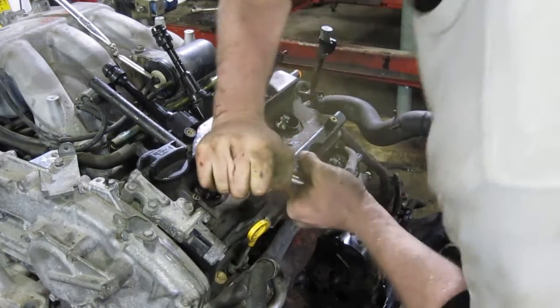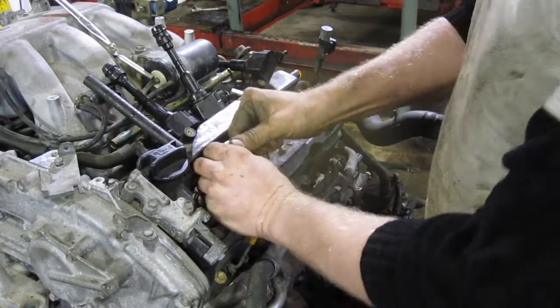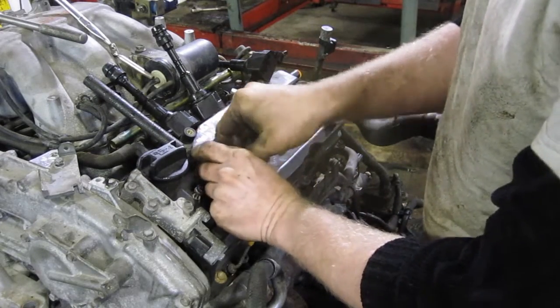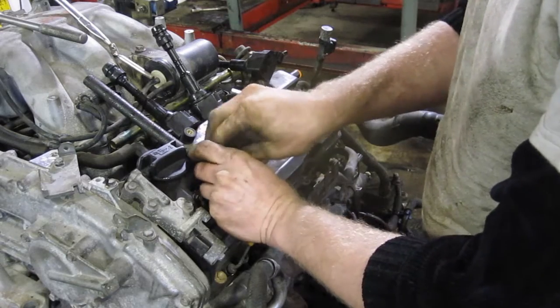You want a nice brown, kind of light film on the plug. You don't want to see white or oil on it. White is antifreeze. Oil means bad pistons or rings.